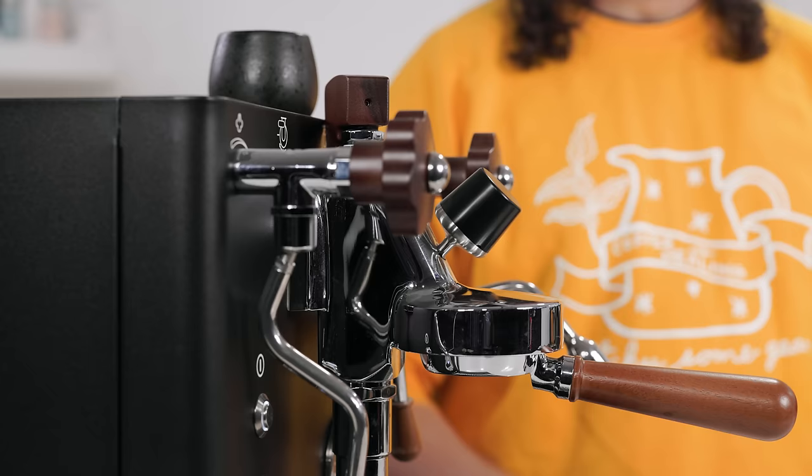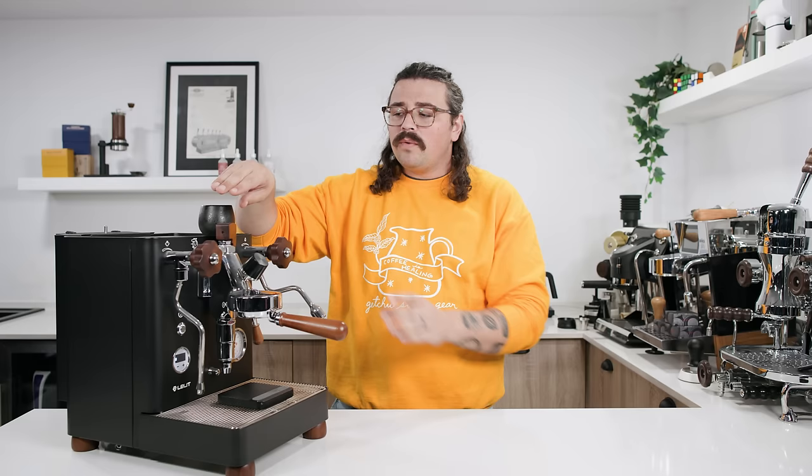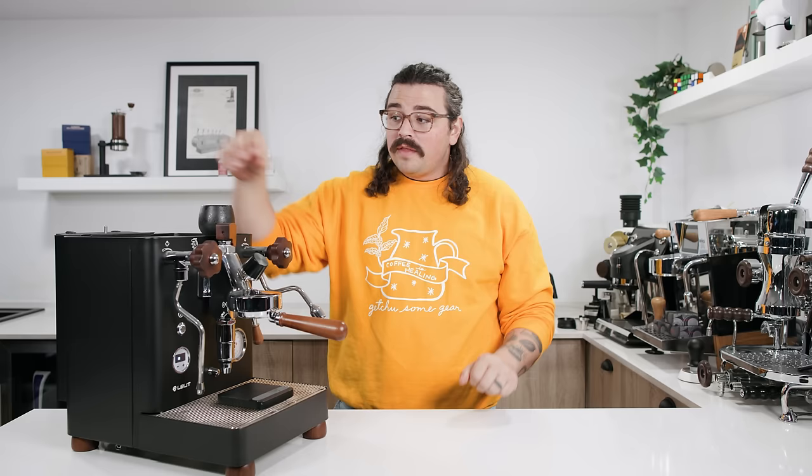Now today I'm using the Lelit Bianca, which has a rotary pump inside. With my valve fully open, it is giving me a constant 6.5 grams per second of water. It's going to be delivering water at that rate to the coffee until it can no longer give that rate because it's reached 9 bar. The OPV in this machine is set to 9 bar. The pump is capable of going over 9 bar, but we have an OPV that disallows it from exceeding that